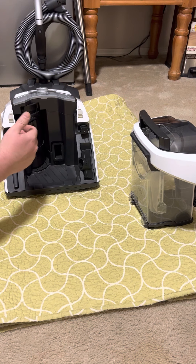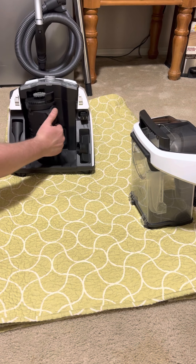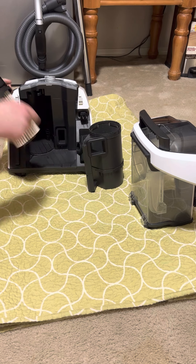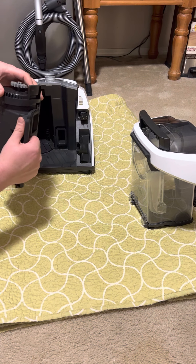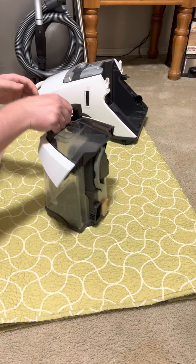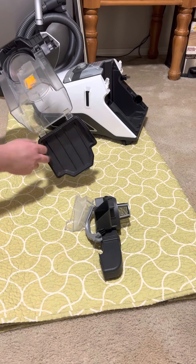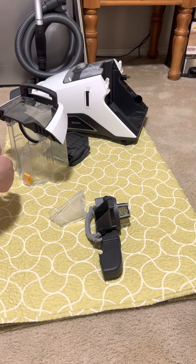If you've just finished vacuuming, what I like to do is take an air compressor, take the gore filter out of the cartridge, and use it to blow the filter off. Put it back in, blow out the gore filter as well, put it back in its place. Then totally disassemble the dust component, take that part out, open it, and use the air compressor to blow all the parts off. Then take a non-scratching rag or sponge, get it lightly damp, and wipe out the inside.